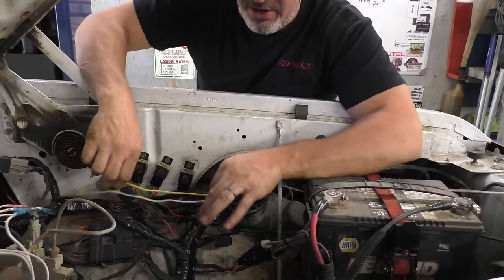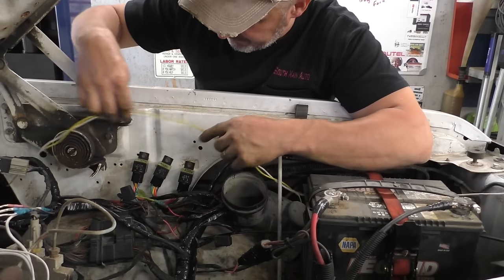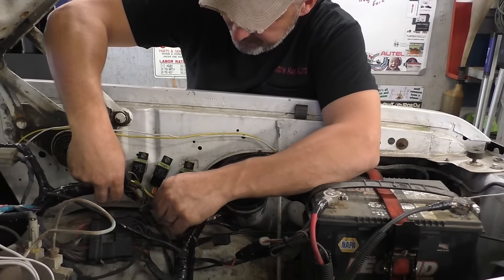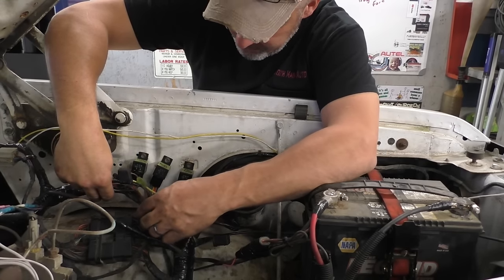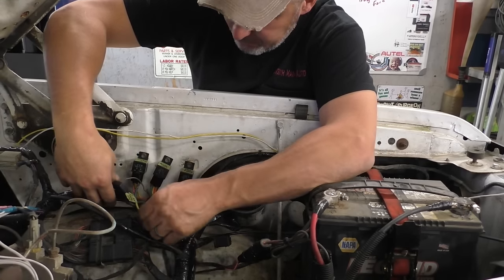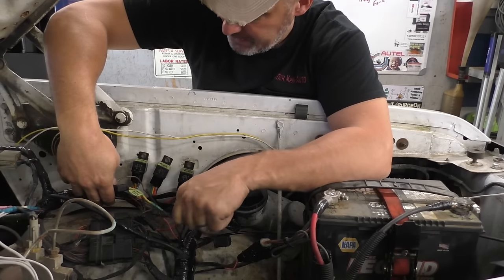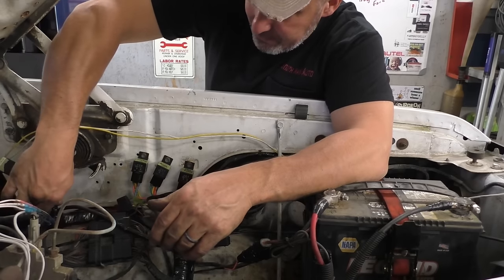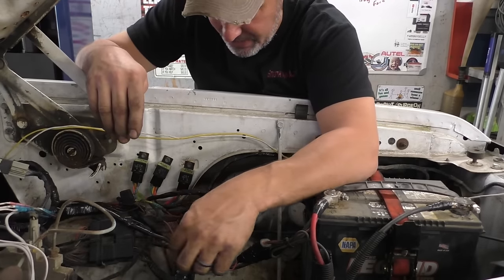Well, these are the wires running up to the visor. I think we talked about that. At least I assume they are. They go down to the marker light. I left all of the fusible links exposed, as you should, including our fuse that we put on here. So I left them out in the open, kind of taped everything else up, did a visual inspection on that